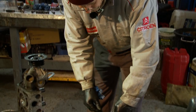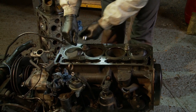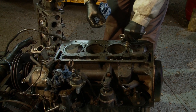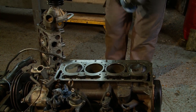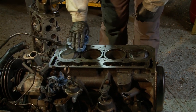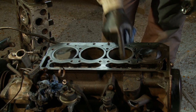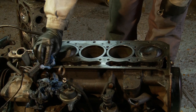Now we're ready to put the cylinder head back onto the engine. The first thing I'm going to do is remove the safety bolts that were put in just to hold the liners in place. We have already done a lot of the donkey work — cleaning up this face very carefully, all the thread bolt holes have been cleaned out thoroughly and chased with a tap, so we know they're all fine. We've also checked out all of the cam followers and changed one because it was just slightly going. But overall I'm very happy with what we've got.